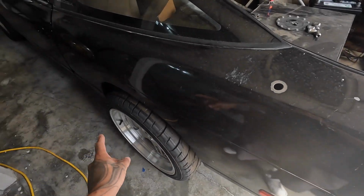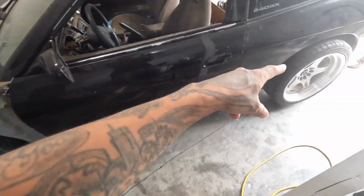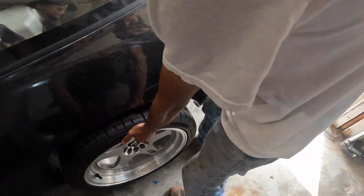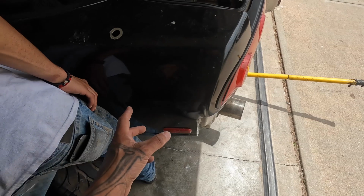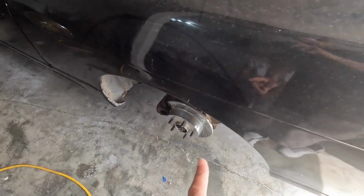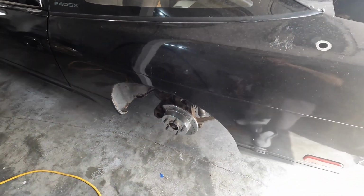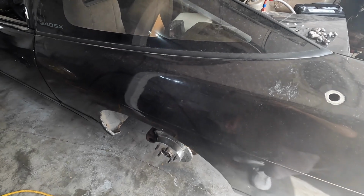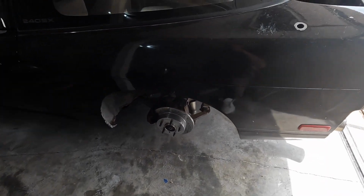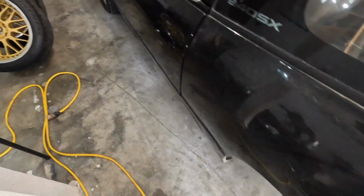We're gonna jack it up and put the wheels that Choco brought, the work wheels, and we're gonna install them on the car. And then from there, I'm gonna take out the shock so that way I can have basically no suspension, so that way I can drop the car down, see where it hits, mark it, and then cut it, jack it up, and then just keep going until it pretty much just drops as low as we can get it. And then slap the overfender on. We'll drill out the holes and do what we need to do, and go from there.